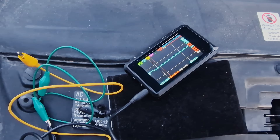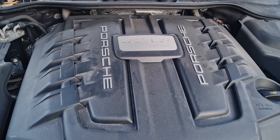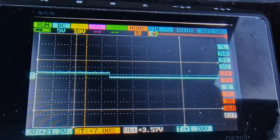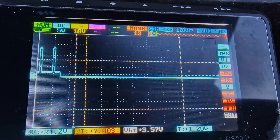But what if this is just a Volvo thing? I got curious, so I took apart my Porsche — different brand, different engine, and six years newer. I connected the oscilloscope and started the engine. And what do we see? Almost the same thing. The only difference is in the details: first the plug gets full voltage, then it is maintained with pulses even after the engine has started.